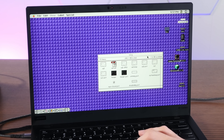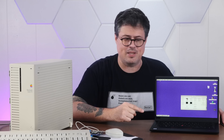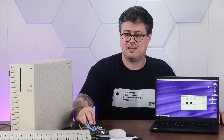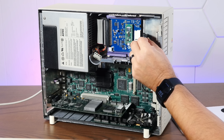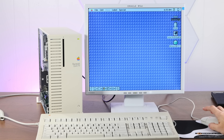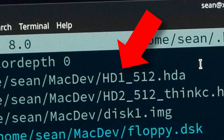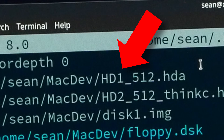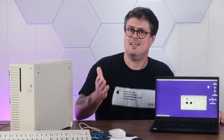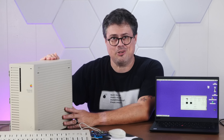Just extremely fast and responsive. What's really cool is that you can take the HDA hard drive image right from Basilisk, copy it to an SD card, and stick it right into a Blue SCSI. This will boot that same exact image from the emulator on real hardware. That's why I named that image file starting with HD1 — that means hard drive one — so the Blue SCSI puts it in SCSI ID 1, and then this Quadra sees it as a real hard disk.